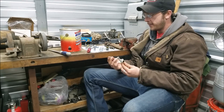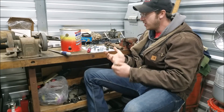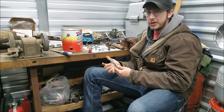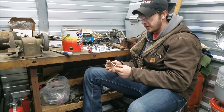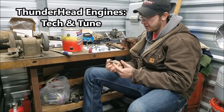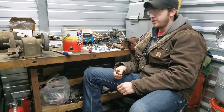That's pretty much it. This homemade tool — more of a puller — works really nicely to simplify the process and make these little plungers super easy to get out of roller lifters. If you've ever tried to do this before, you've probably struggled pretty good. If you're interested in the tool itself, I could make a few more assemblies and sell them. You do need a welder to put a bit of extra material on the bottom so it grabs the plunger. Check the Facebook page linked above — maybe we can get some discussion going on tech and tune questions.